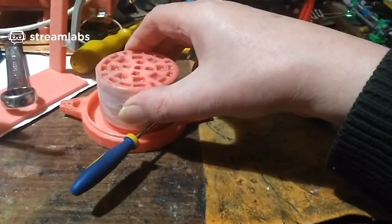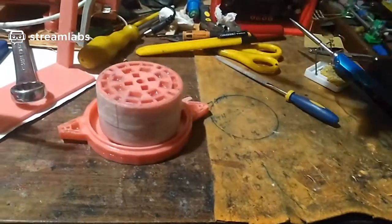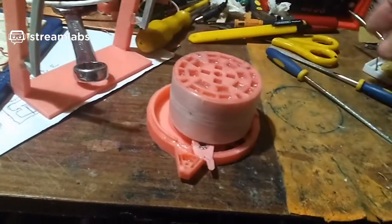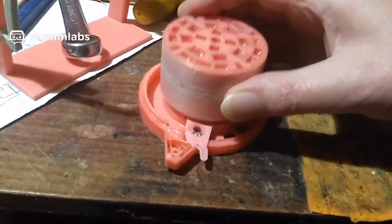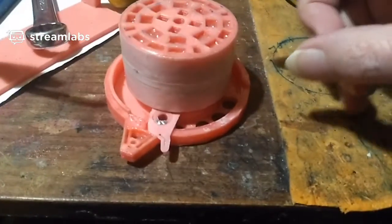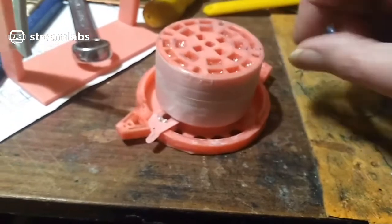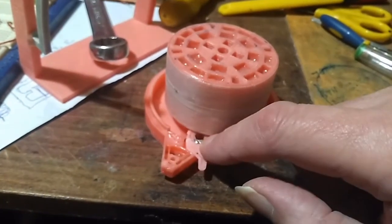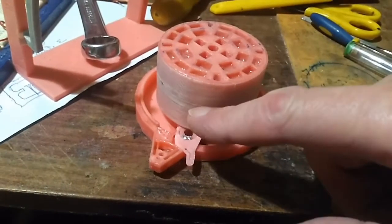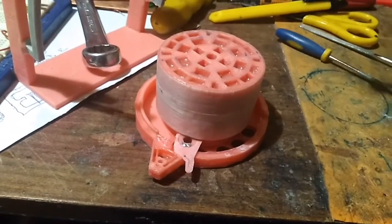If you look at the line alignment, the trigger coil is mounted right on that edge — right in the middle there as I'm turning it around. So the trigger coil is right there on the edge of the drum where it can pick up the flux to do the triggering. I don't have to have the trigger coil mounted directly over the head — it can just be on the side of the drum.